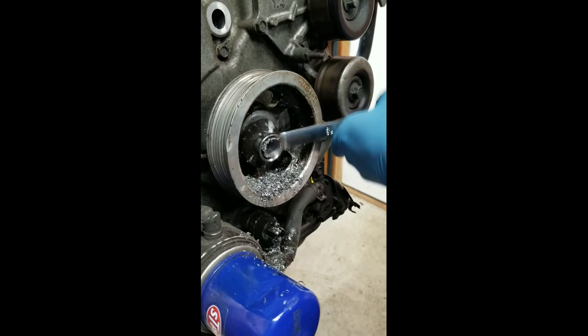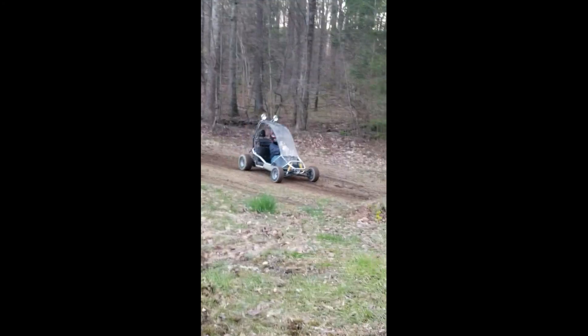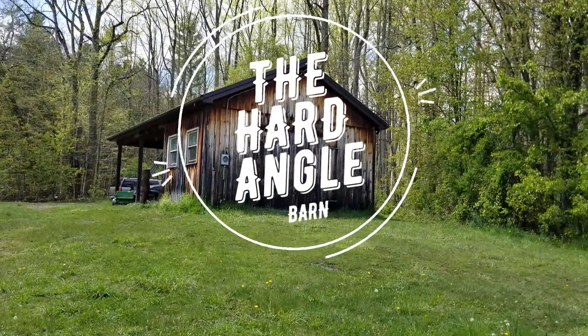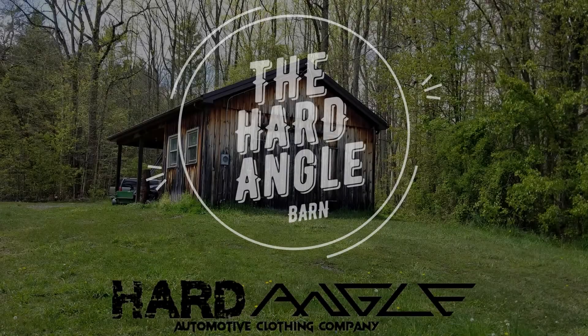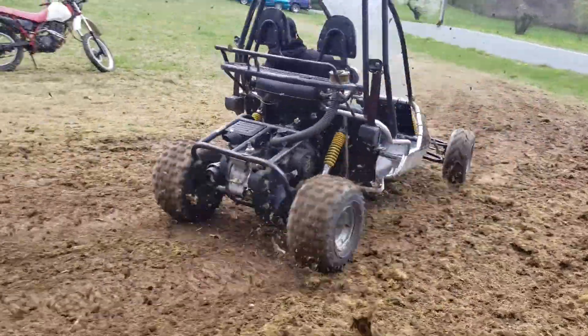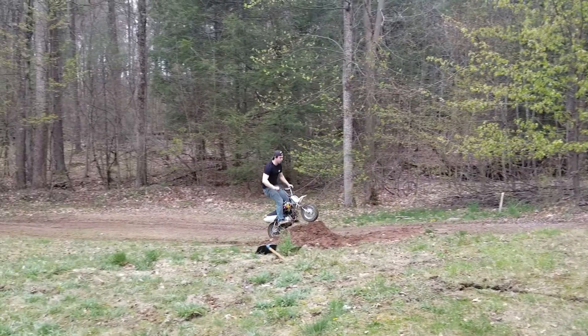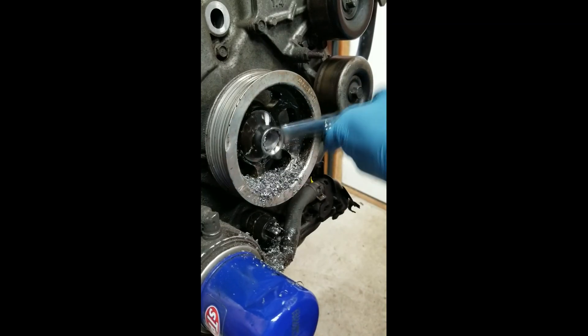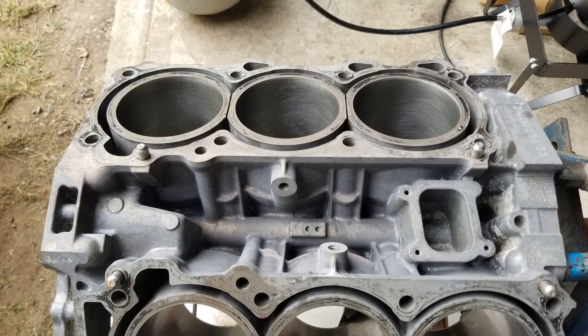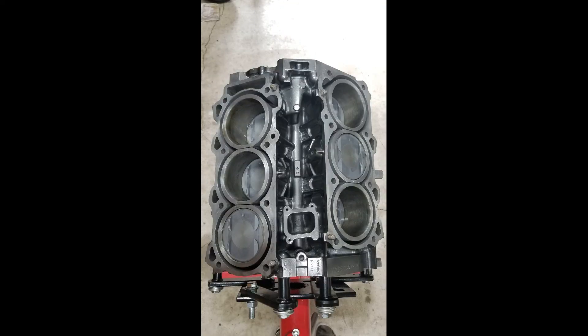I just want to finish up this found-footage video. As of editing on December 16, 2020, this was filmed back in early August when we were still in the middle of the G project. The second part of the G video got posted about three months after it was filmed — I just never got it edited and wasn't really feeling it. I got a burst of motivation and I'm getting through a bunch of videos right now. Here's a picture of the Altima block before I hot tanked it, and this is after — it looked pretty good. After I honed the cylinders, put in the bottom end, and painted it up, this is what it looked like. The hot tank works great; I've used it on a whole engine already.